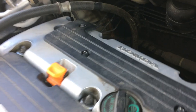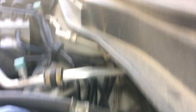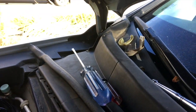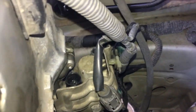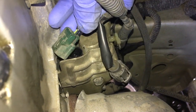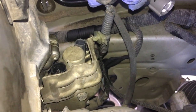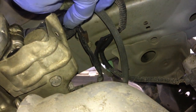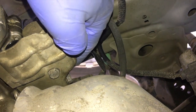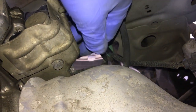I've removed the power steering hose bracket — that's what it looks like right there — with one 10 millimeter bolt. I used a pick to disconnect the wiring harness off the bracket and disconnected the two two-pin connectors from the assembly. Next we're going to undo one, two, three 10 millimeter bolts off the back of the motor to take that spool valve out.